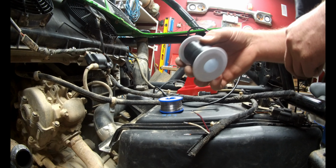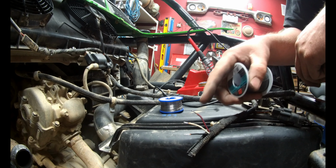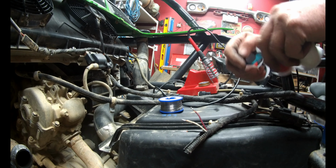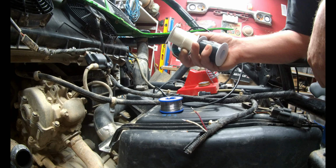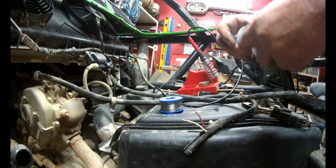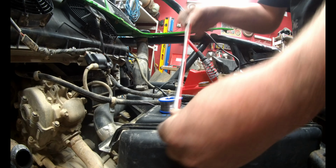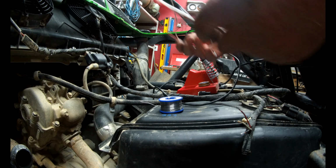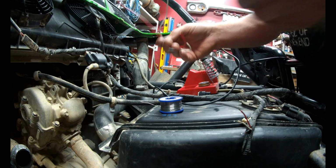So we just picked up auto wire from a local store around here. So I've got black, white of the original wire, and there's a purple red, which I couldn't get, so I've just gone with red. So that was all about close to $30. Still cheaper than buying another wire loom. Okay, here's our replacement wires. I've made them a little longer. I'll cut them shorter once we get there and to the end there. Once these are all soldered in, we'll see how long we need it.